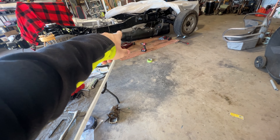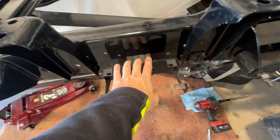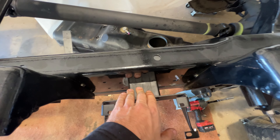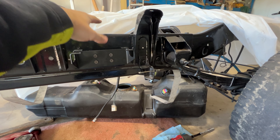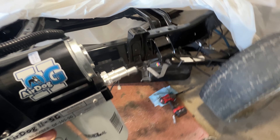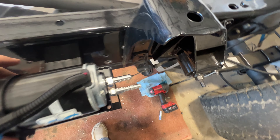New plan — ended up disregarding the mounting plate because of how wide a second gen frame is on a single cab truck. I don't have much of the smaller C-channel to work with. So I went the old-fashioned way and just drilled four holes into the frame, and it will just sit right here on the bracket. I do have the spacer, it clears the frame mounts, and there's nothing here for the fuel filters to rub on. The bed is going to sit right here and actually clear the mounting itself.